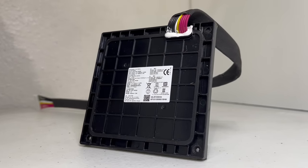Now to remove the bottom panel, we will need to take off the wheels. On the wheels, there is a cover that needs to be pried off to reveal two bolts that need to be removed. Here is the wheel cap — they look almost identical to those on the Flip lineup. With both caps removed, we will need to use a tool to hold one end of the wheel nut while we twist the other one. Here we have the wheels — they contain their own bearings to help produce smooth rotation with minimal friction. The only issue with these wheels is that they are quite small, so you may struggle wheeling the speaker on certain terrain such as grass or a sandy beach.